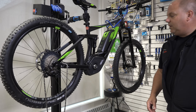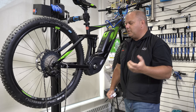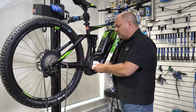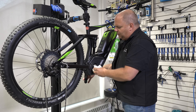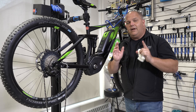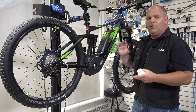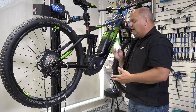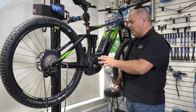Now we definitely want to grab a paper towel. If your bike is really dirty, grab a toothbrush or small bristle brush. We want to clean this area off — get rid of all the old grease and gunk, and make sure this thing is as clean as possible. Never use a pressure washer in this area; there's no point forcing water into the drive unit zone. Paper towel, brush, some soap and water — just gently clean it, and try to avoid forcing a lot of water in this area.